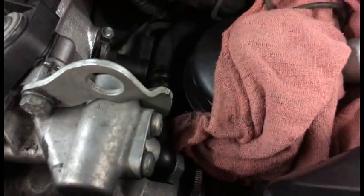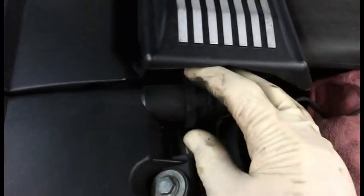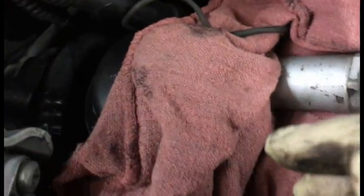It's gonna leak some oil, and then you take that off. While you're doing this repair, because you're gonna have to get under the intake manifold, you're gonna have to take off this vent tube. So I'll just take that off in a second. If you've got tiny hands, you can reach under there and disconnect this wire. Somewhere up in there, I gotta find it and disconnect it.